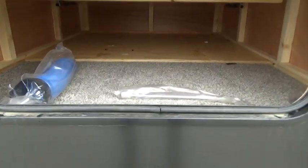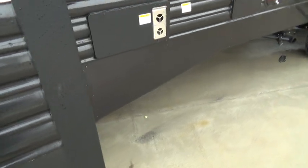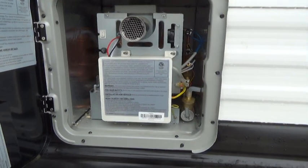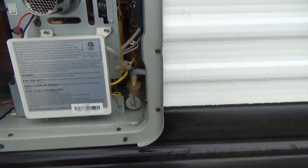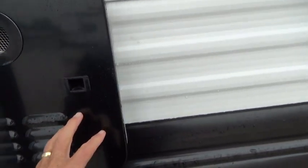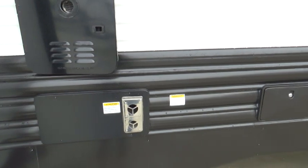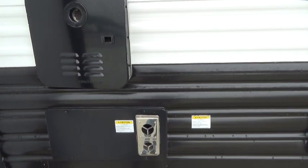On the driver's side, you'll find your storage area, and you can also access it from underneath your bed. This is your demand water heater. Your demand water heater does not need to be winterized — it'll be winterized when you winterize the whole unit. You do want to make sure, by checking the blow-off valve, that there is water in the system before you start, and that way you'll keep your water heater in good shape. It's best to run the hot water until it gets hot before you add cold water to it. If you try to add cold water before it comes out hot at the faucet, then it will not heat properly.